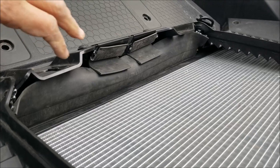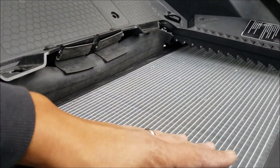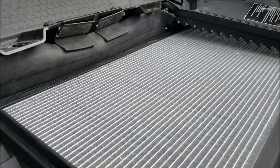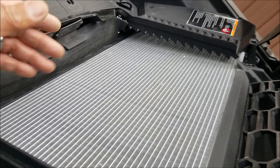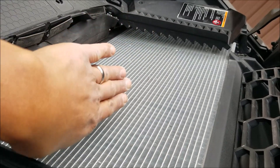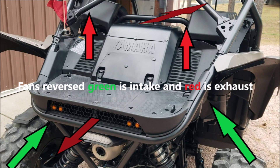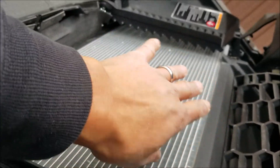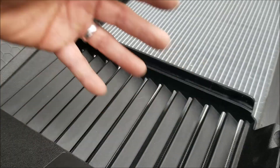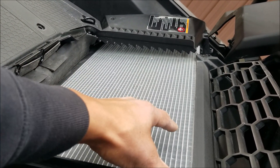What I've done here is taken some rubber channel and blocked off this rear path, so that when my fans are reversed and blowing hot air out, it's not blowing out the back — I'm capturing all that heat. By modifying my radiator shroud and removing that divider, normally you only get this portion of the radiator providing heat and the other heat is blowing out the back. Now with that divider removed, I'm getting all the heat from the center of the radiator. For the winter, you remove that divider and you're going to double your heat into the cab.